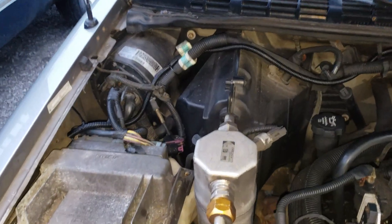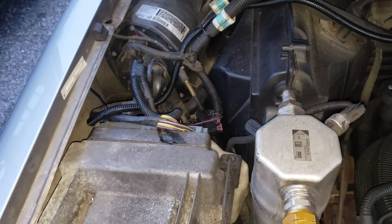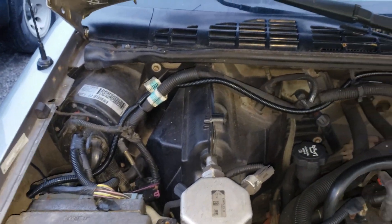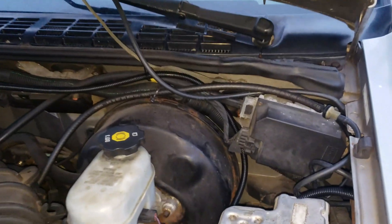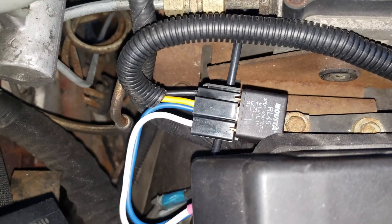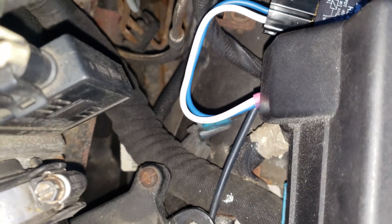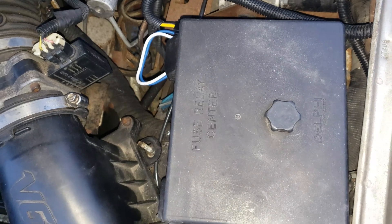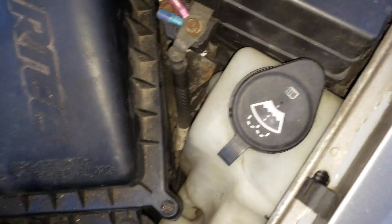Here you can see we cleaned up the wiring. Pin 42 is a negative — the computer connects a ground — so we have that trigger wire grounding out all the way across the truck, and then we bring it down and use that ground signal to trigger the relay. I've got the fan main power and the switch power that goes to the computer all tied up to post B on the fuse panel, that way it's already got a 30-amp fuse taking care of it. We cleaned up the wiring running all the way down to the fan.